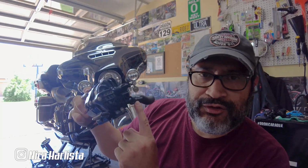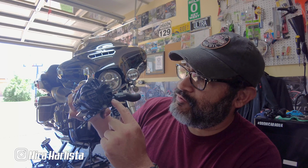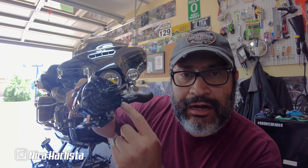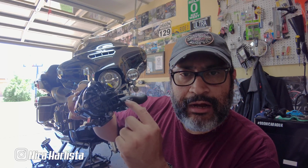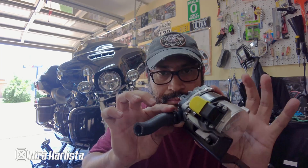And what I tried to do, I think that's how they're intended to be done. There's a little arrow on the pump right here. So I tried to align the arrow with the hose arrow. And I think that's kind of the spot for aligning. So what I'm gonna do is crimp this clamp before installing, because it's more comfortable. So that's what I'm gonna do right now.